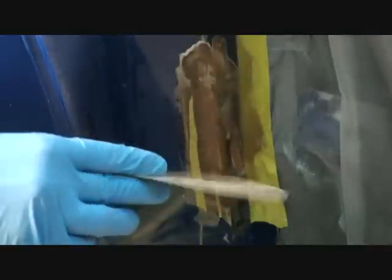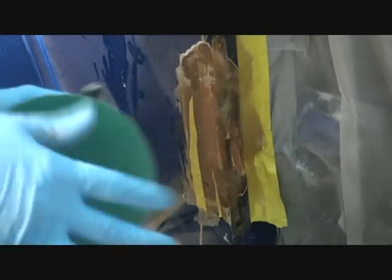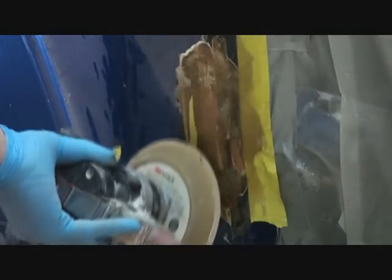What you're going to see here, this is 36 grit — this is a DA-36. Now this can actually be hand-sanded, but I'm going to be honest with you: it would be a very, very big job to hand-sand that area and actually make it look right. It would be a major disaster job. Fiberglass is as hard as a rock — it's actually machine-sanding type of material only.